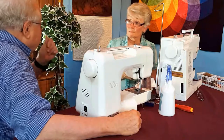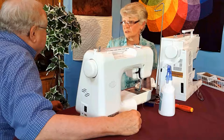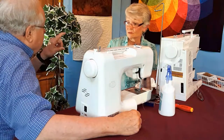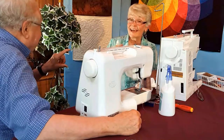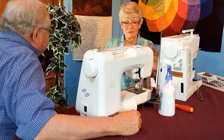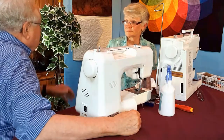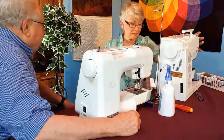Does oil have a shelf life? Yeah, I would start being concerned with oil at about 7 years, because oil goes from being a lubricant to an adhesive. So I shouldn't buy the can of oil for sewing machines that I bought at the flea market? No. And I know the pretty little coned oilers, they're so lovely. If you put that in there, you're going to have a really hard time getting that oil out of there, because it's going to be like sludge. So it's just like the expiration date on a can of peas or beans. Absolutely.